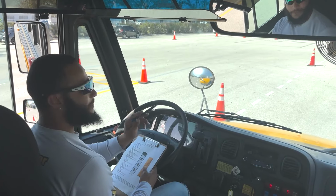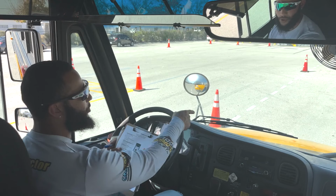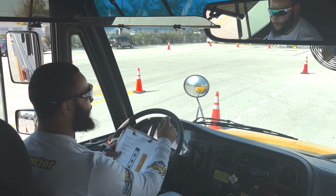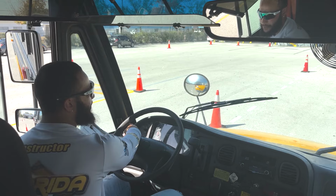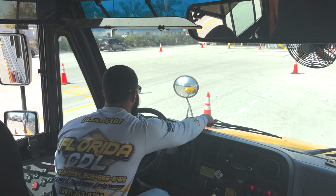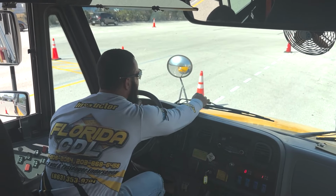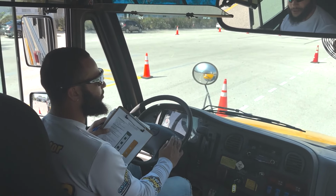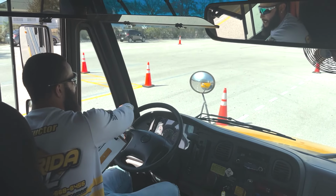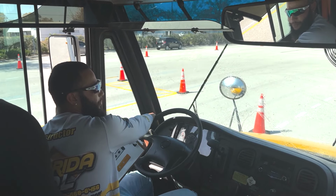All right, now after explaining the windshield and traffic monitoring devices, we're gonna go ahead and move to the wipers and washers. So first we're gonna mention that the wipers are working properly. Then we're gonna mention the wiper arm, wiper blade, and wiper rubber are all secure with no cracks or cuts. And check that the washer fluid is working properly.